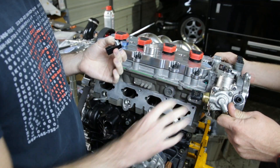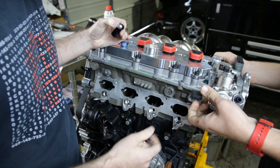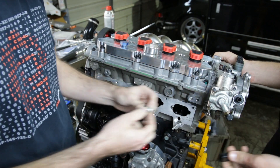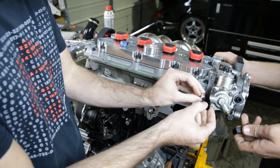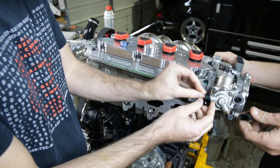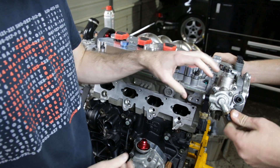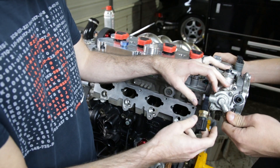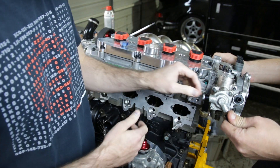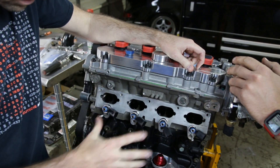So now we're actually getting ready to install our manifold, but before we do so, this fuel pressure sensor has to be relocated. Integrated has this banjo bolt relocation, so we're going to thread that in place, and then it allows you to have the banjo bolt there and relocate the sensor here. Since we're not exactly sure what orientation we want this to be in, we're going to leave it loose for the time being and then snug it up later once we've finalized the location of the sensor.